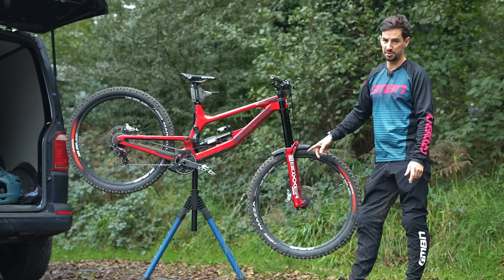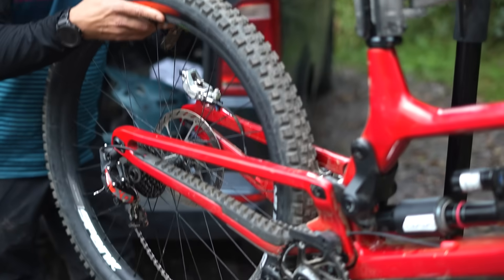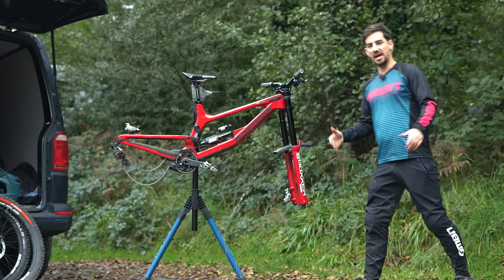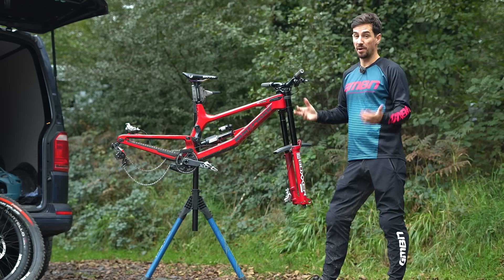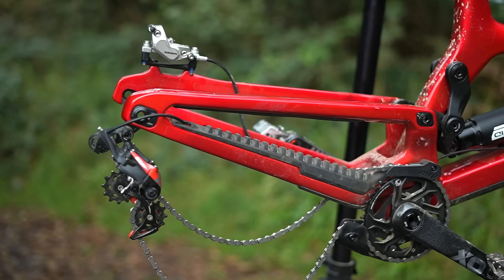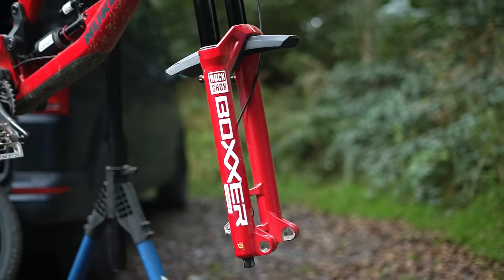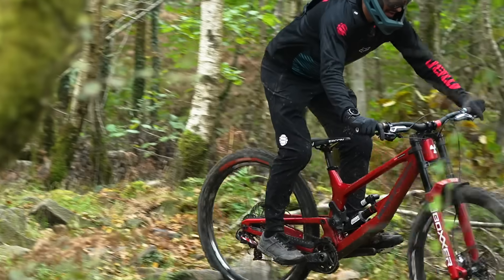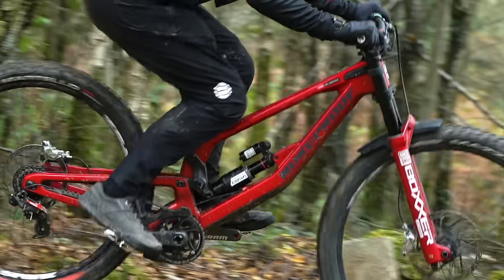Let's start with explaining sprung versus unsprung. The unsprung mass is made up mostly by the wheels, the tires, the axles, but also the discs, and anything on the swing arm including the swing arm itself. So the derailleur, the caliper, the swing arm, and the fork lowers are all unsprung mass. The lighter these things are, the better your suspension will work, and the more reactive it will be — both being able to compress and rebound easier and quicker without adjusting that suspension at all.